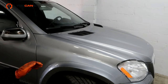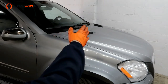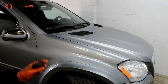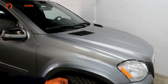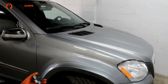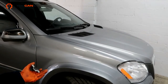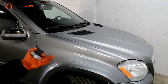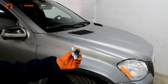What happens is these sway bar bushings that connect the sway bar links to the strut on this side and on that side — or in some models connected to the lower control arm — these sway bar bushings wear out. When they do, as you drive down the road, especially on a road in poor condition, you will feel the front end of the vehicle be really loose. Other than that the vehicle could drive fine, stay straight and not pull. If it does pull, you've got another issue.